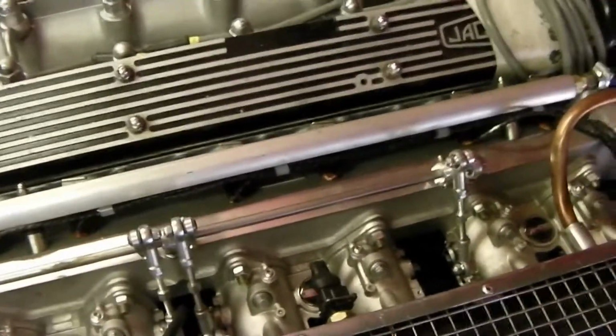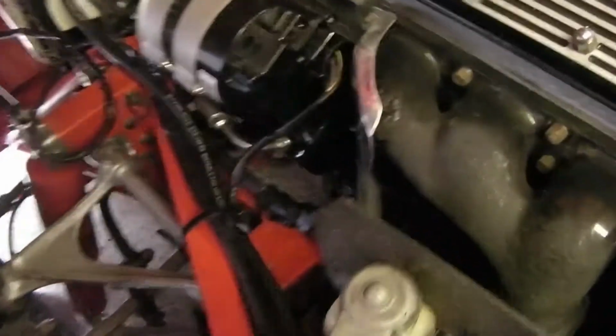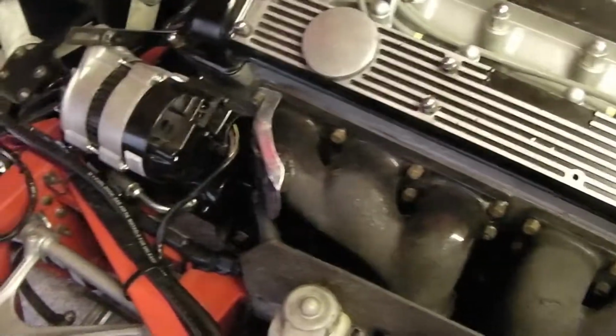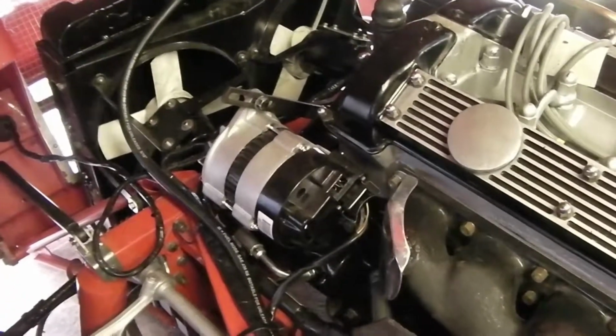The other important thing I added to this car was the lambda sensor. Okay, the lambda sensor control box is here. Difficult to see, but the lambda sensor is down there on the exhaust pipe. Needed a bit of stainless steel welding because it comes with a boss that you need to weld onto your existing downpipes, so that the actual lambda sensor is the correct distance from the actual head itself to give the correct readings.